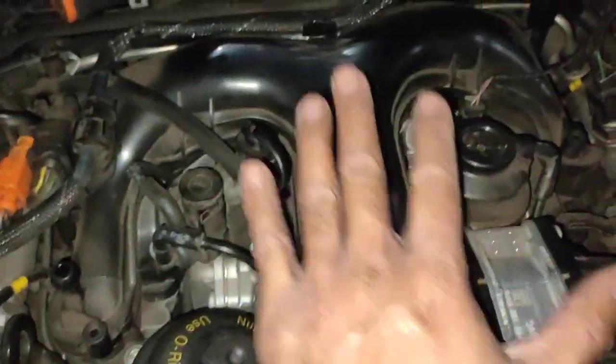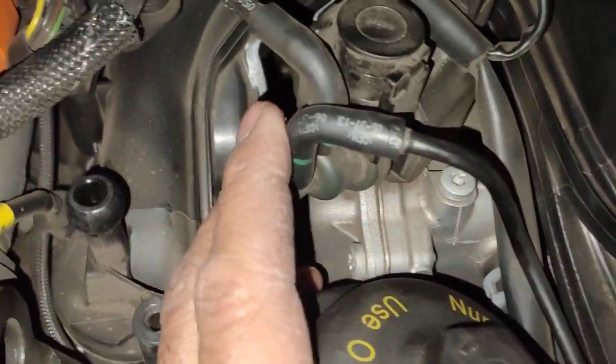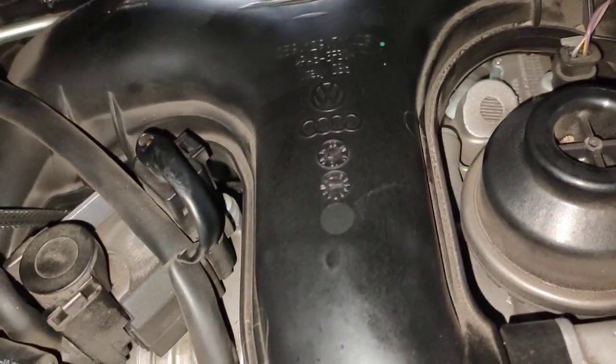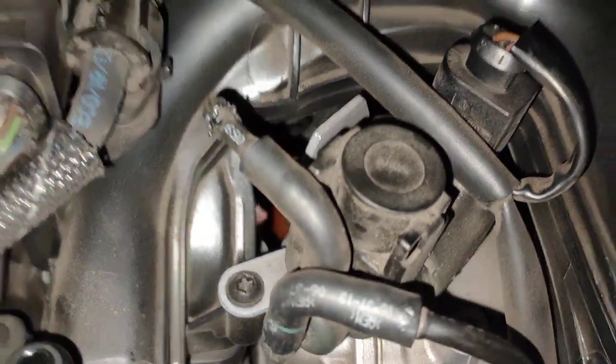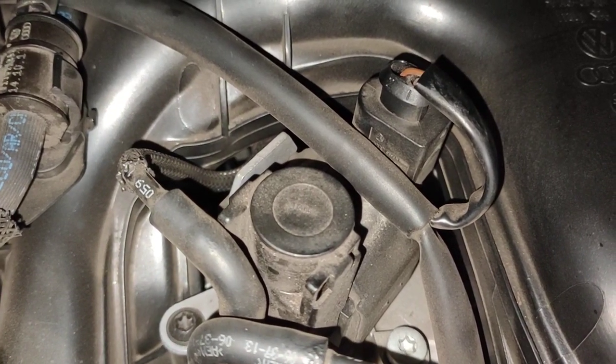Which are inside here. I need to remove the intake manifold and the EGR cooler to have a proper look so I can see where the coolant leak is coming from. I can tell you right now it's coming from either the plastic socket — it usually comes from the plastic one, the plastic socket that goes on the EGR cooler.